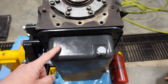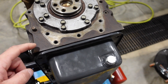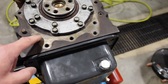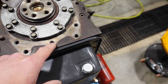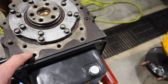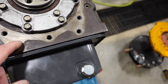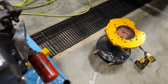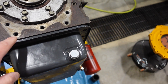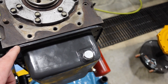Number one is the oil pan. The big cast carrier oil pan actually protrudes back past this part of the block. You can kind of see where the factory transmission bell housing adapter — flywheel housing adapter — actually married. You can see there was a gap at the bottom, so they didn't have that issue. But since this plate is going to go all the way down here, you might have issues with the oil pan. Even this Kubota oil pan can stick out.